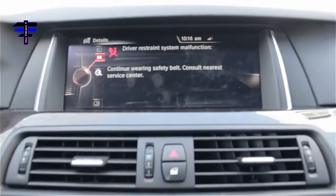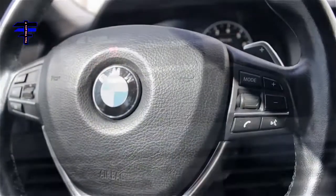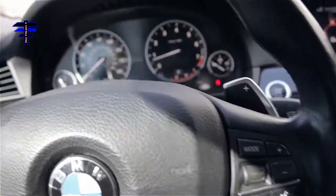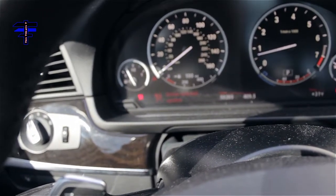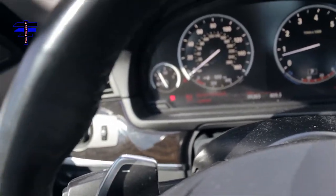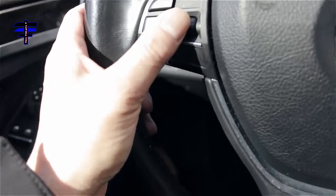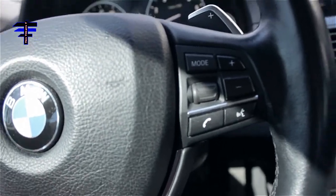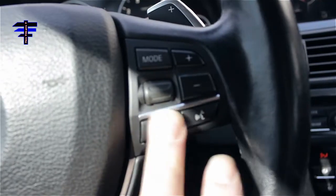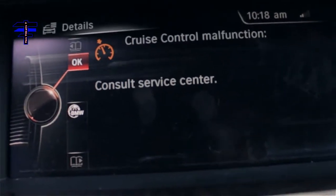And this is the reason why I need to replace it. I can see right there, it's a driver restraint system malfunction — there you go, better view. It does say driver restraint system, with an airbag warning light. That's the reason why I'm changing it. Also the horn is not working, cruise control is not working, this is dead, and if you move left and right you can hear some squeaking. All the buttons don't work at all — nothing works. And there's another one: it's a cruise control malfunction. Alright, let's go replace this.